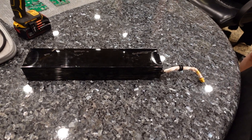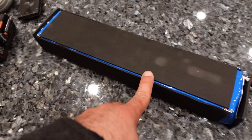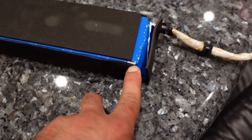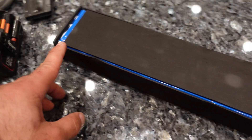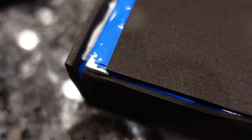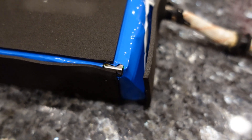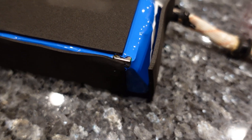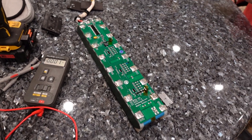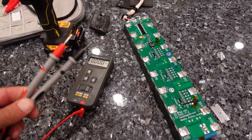You've got the latest version - version 2. These packs are the 67-volt packs. The old 33.6-volt packs would have these nickel strips that basically evaporate - I've actually had my wheel fail because of that. On here you can see they get hot enough to go through the shrink wrap, but they don't look corroded, oxidized, or anything weird. It still looks safe, but if it's creating that much heat they probably should have used thicker nickel strips.